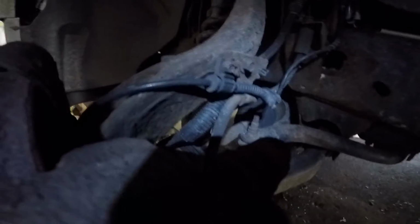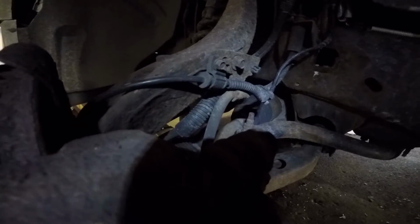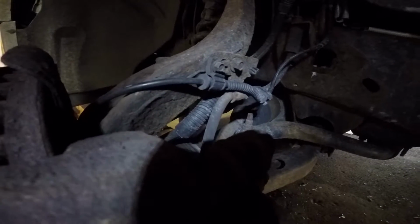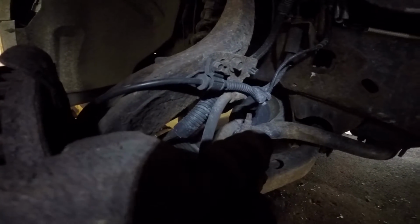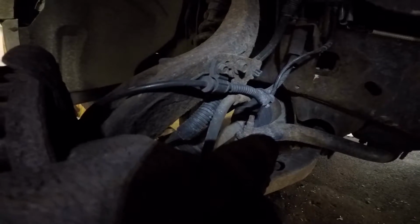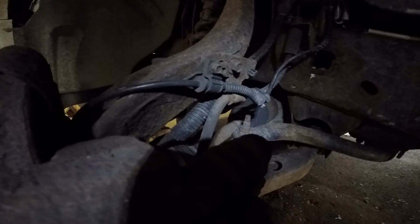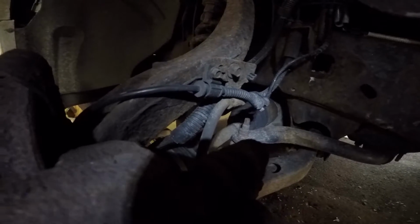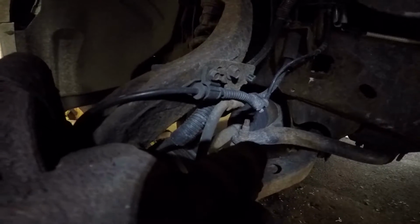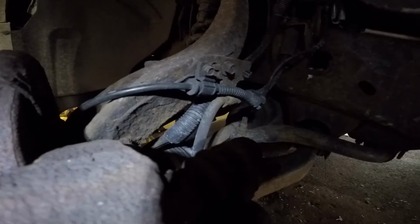I noticed when I hit the brakes, it doesn't wanna release the brake until after 10-15 seconds. So it's hard to get running again or driving. And this is the issue. I have another Expedition that had the same issue. I bought a new brake hose on that one, but now I'm gonna open it up. This may save me a couple of dollars.